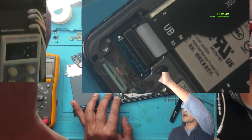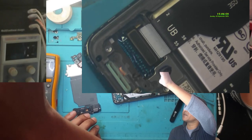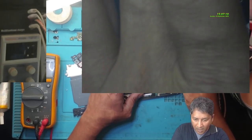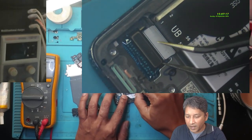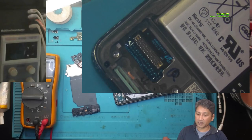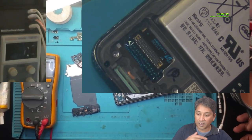Unfortunately I can't show you properly on the microscope because it's only 2D, but to my eyes this connector doesn't look like it's sitting right. As the customer explained, the phone did have a display right after the drop — he switched it on, had display for the first few seconds or a minute, and then while he was using the phone it suddenly just went blank.